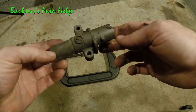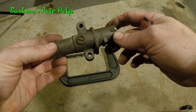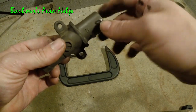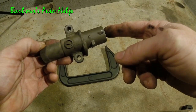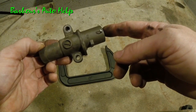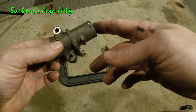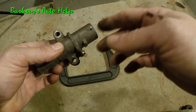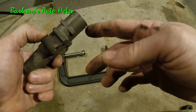This is an old auto tensioner. If you're replacing your timing belt, doing a water pump, or whatever — typically you've got over 60,000 miles on your vehicle, maybe even close to 100,000, whatever the service interval is — with the wear, tear, and age, I think it's a good idea to go ahead and replace it. So my suggestion would be to replace it just to be safe.